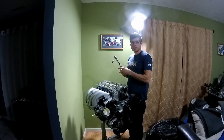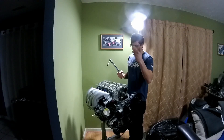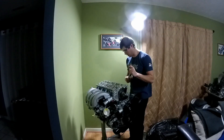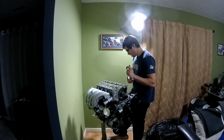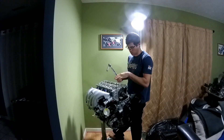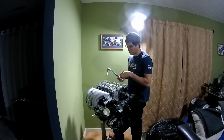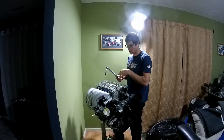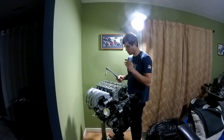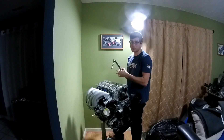All right, we have all the bolts in, finger tight - number one on the clutch, which is next to nothing when I throw the studs down. It's got all the special ARP torque lube on it, and everything is torqued to the first step. So now we'll go through in order and just torque them in sequence. We're going to do two bolts, three steps, up to 70 foot-pounds. The first step is 23, next one will be 46, last one I'll do is 70.